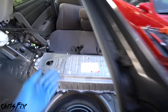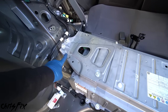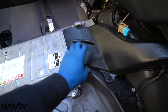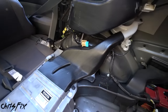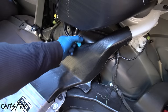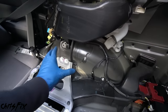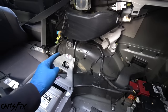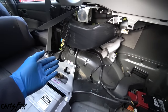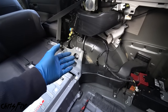Now remove the four 14-millimeter bolts holding the back seats in place — these are the only 14-millimeter bolts in the entire job. Slide the seat forward, which gives us plenty of access to the front of the battery. After seeing all these panels, nuts, and bolts, you're probably wondering how to keep them organized. What I do is lay them out so you can see exactly where they go — driver's side on this side, passenger side on that side. Use a storage tray or baggies, and take pictures; it's a lot easier when you're doing it yourself.